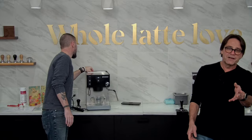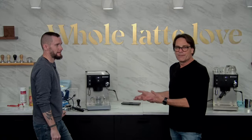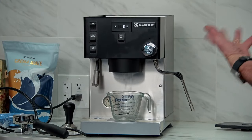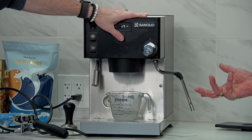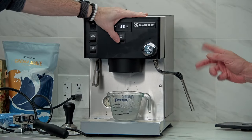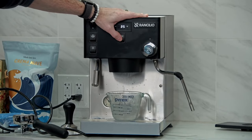We will take your questions, so don't leave the guys back there lonely. Now I'll press the brew switch — we've got a nice flow of water out of there. Good rule of thumb: if a machine doesn't tell you how much water it wants out or give you a set time period, always run a cup through. A lot of machines now have fill programs where you pretty much have to run it for at least 30 seconds before the machine's happy. Make sure your boilers fill up. Generally speaking, if you let it run for 30 seconds you're going to get around a cup out.